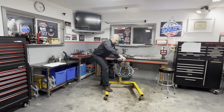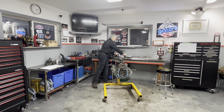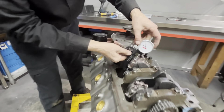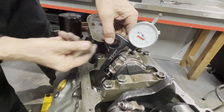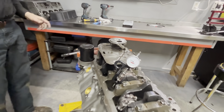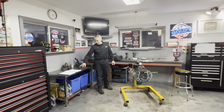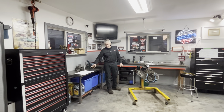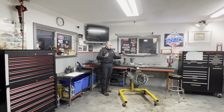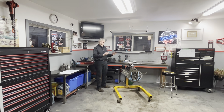Going from 63 to 80 foot-pounds in one smooth motion. Measuring the stretch - I got five and a half, a little better than five and a half thousandths. The spec says 0.0059 to 0.0063, and another ARP spec I looked at says 5.5 to 6 thou. That's good - we're right in there.